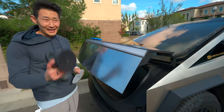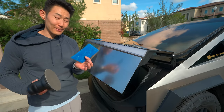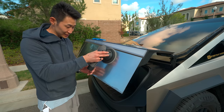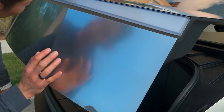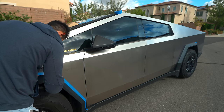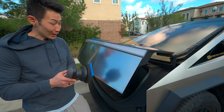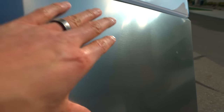I'm just going to repair this back to how it was. I've got the handy dandy polisher with the 3M Ultra Fine Pad — we're going to use this to make everything more uniform. Then we'll use the Scotch Bright Pad after. I have it on level two setting — barely any pressure. The whole point of this is to remove those uniform straight scratches. Jumping up to level three. It's just a little bit more uniform and a little dull — that's the whole point; we want that dull finish. Make sure you use blue painter's tape and tape off any plastic trim in the area because it will scratch your trim. Then we take this off and use the Scotch Bright Blue Pad — barely any pressure, just helps create a more uniform finish. It removed those straight edges and made everything much more uniform.